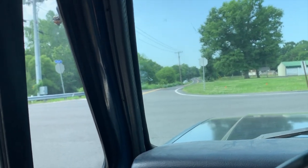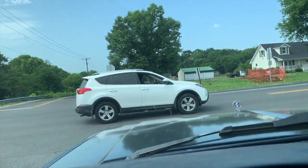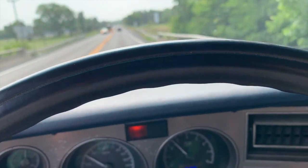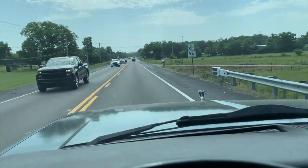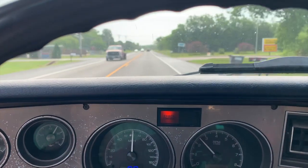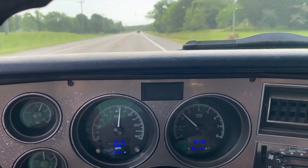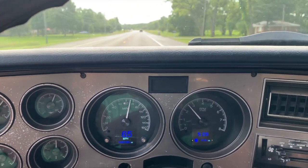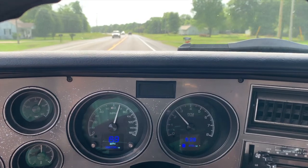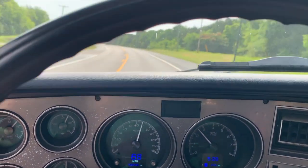We'll wait for some traffic here. RPM, but it's still in a high stall situation, as you can see. That light will go off 20 seconds after I let off the brake. There it goes. Now we're back to a low stall. So we should be able to run our regular road speed here. It should be about 67 is 2,500 RPM. So no extra converter slippage. This is kind of neat.